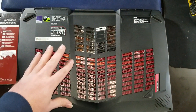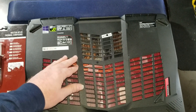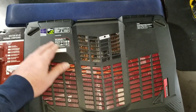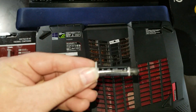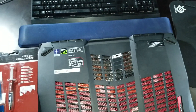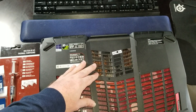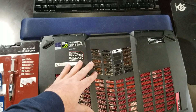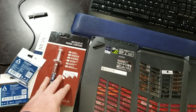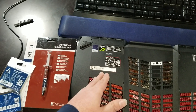So here we are, another EcoBelkin video. This one's on replacing the thermal compound for an MSI GT73VR laptop. I've replaced it once already with Arctic Silver 5. It's okay. My attempts on the GPU side anyway are still in the 84-85 degree range when I'm playing my games. So I'm going to replace it with Noctua's thermal compound. I've read good things about it. We shall try it. If not, maybe liquid metal.